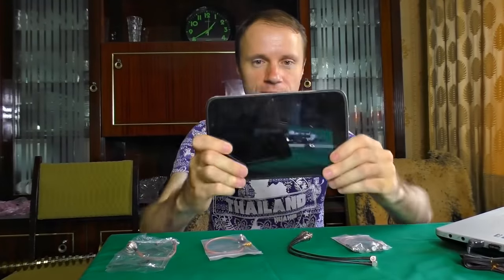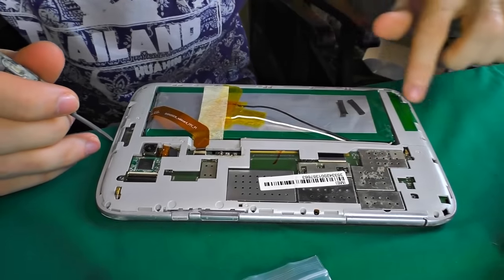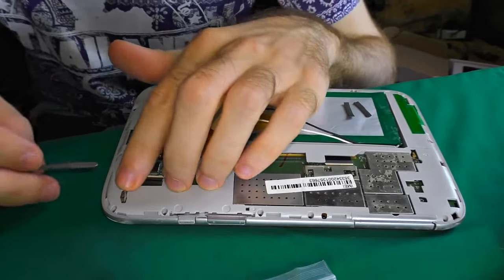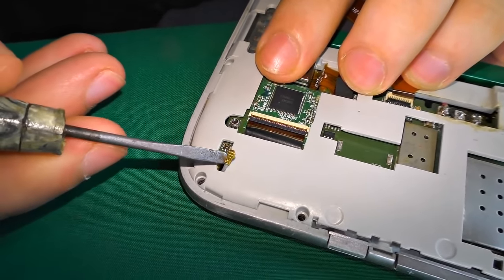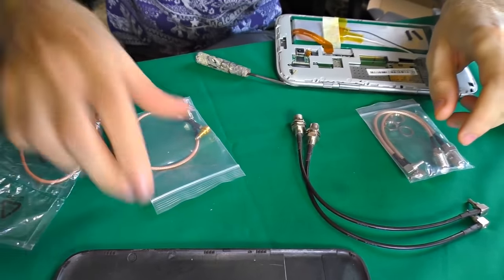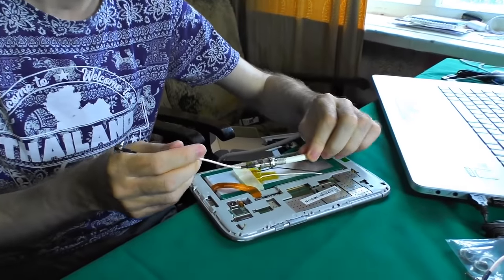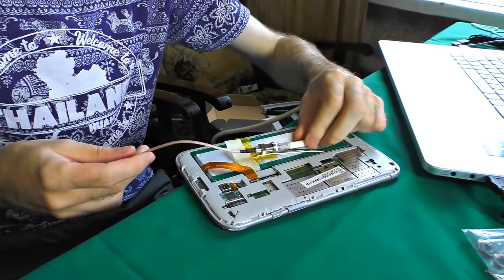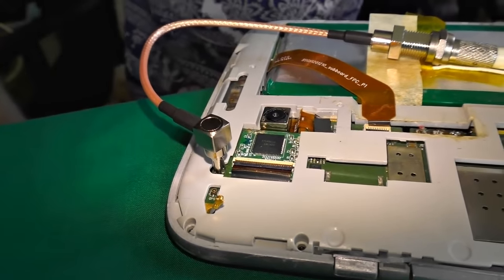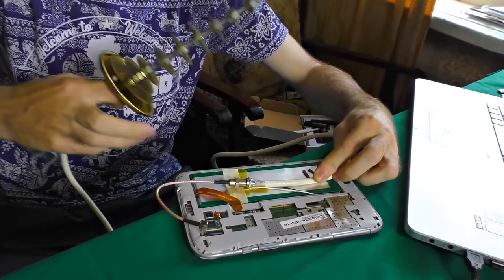By the way, we can also connect this Wi-Fi gun directly to a tablet, for example. We have a GSM antenna and a Wi-Fi antenna — we don't need the GSM one. I plug out the Wi-Fi antenna carefully. Then I connect a pigtail to this input — I have a collection of them. Connecting the pigtail to the wire. To fix it better, I recommend you to wrap it with scotch tape. As a result, you will have the Wi-Fi gun, a cable, and a tablet — no other devices required.